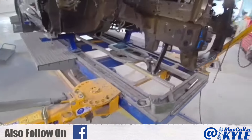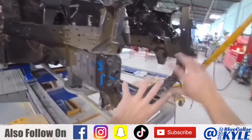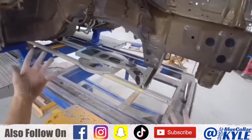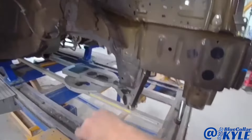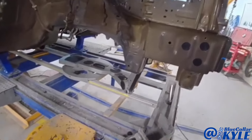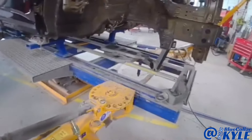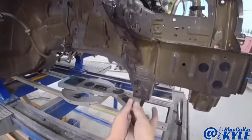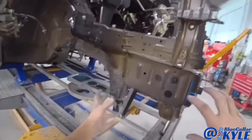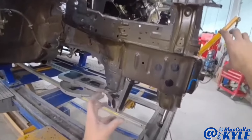This has been a little bit of a pain. As I'm pulling these frame rails over, it's actually moving this perch right here, which is where the engine cradle mounts. It's moved this too far over and this not enough. So I put another ram on here — I'm going to grab this and pull it this way a little bit while I pull the frame rail that way, so I've got to tweak both simultaneously.